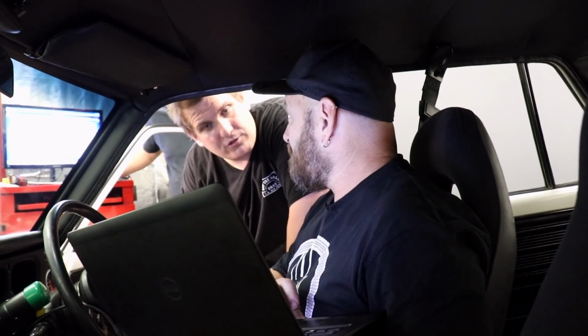Good to go, Timmy? Good to go. We've adjusted it and we're seeing 0 at the motor, 0 at the ECU. So the two are synchronised together with the engine. Okay, so we just had to change the offset angle 20 degrees and it's pretty right. So that's pretty easy. You don't have to actually touch the distributor or anything. You just do it on the ECU.